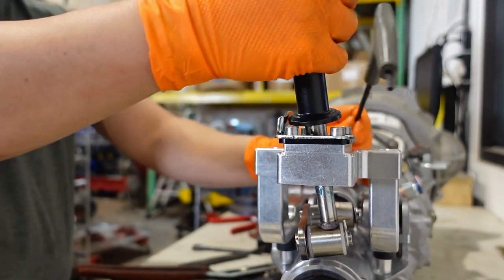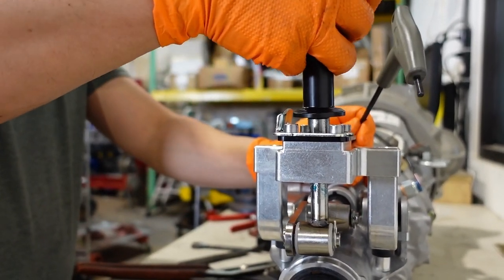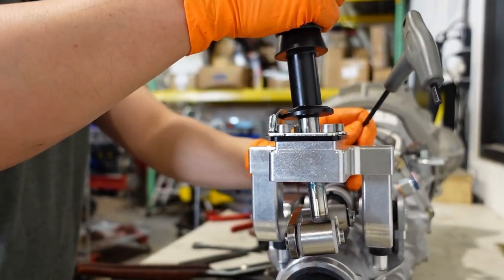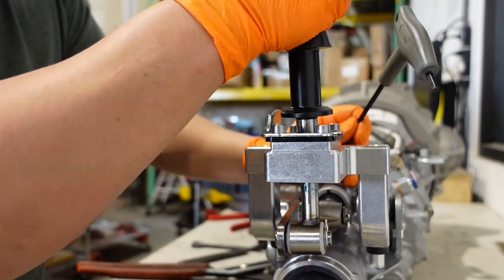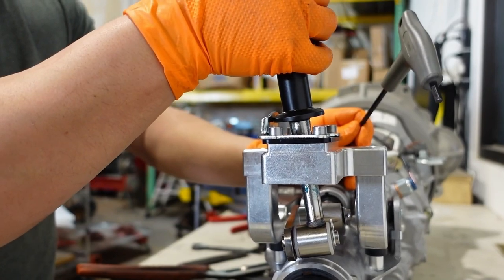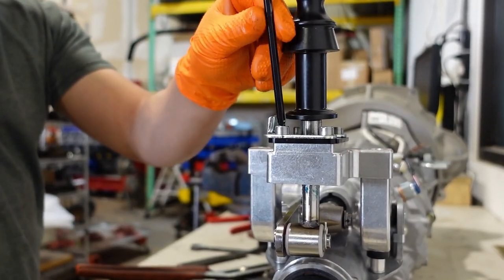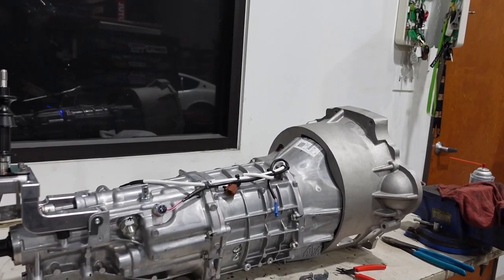You want a small gap to account for things like bushing wear and the force you're applying to the shifter rod. If it's too tight, you run the risk of not being able to locate first or second gear. Once all bolts are tightened, do a quick function check to make sure you can get into all of the gears, then give all four shifter plate bolts a final check for tightness.